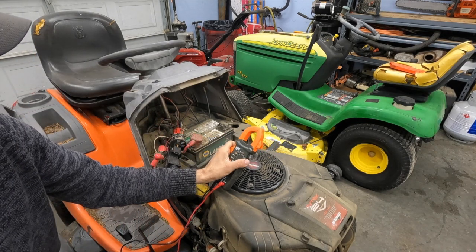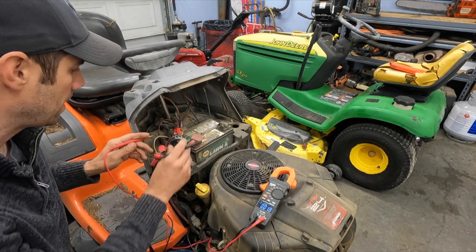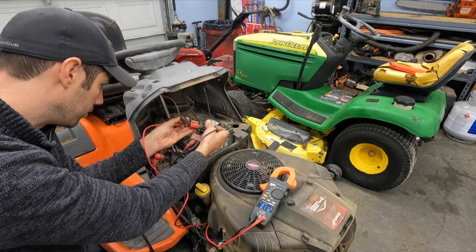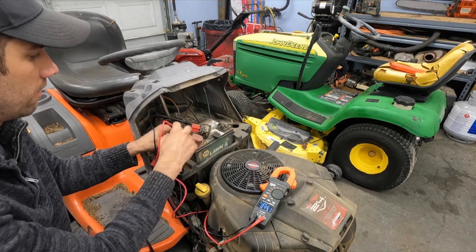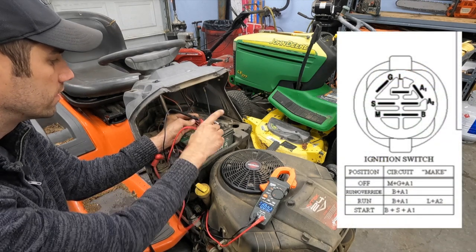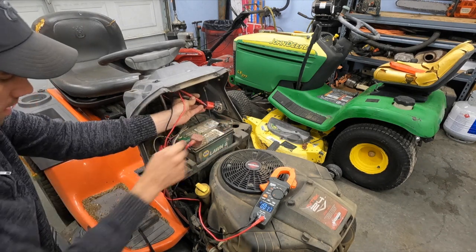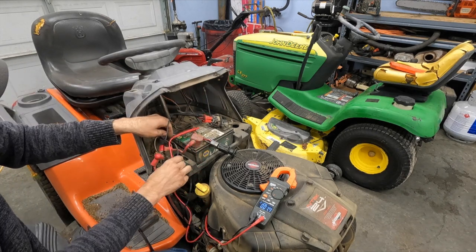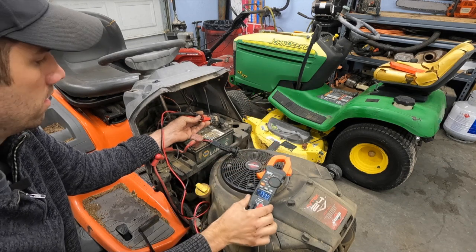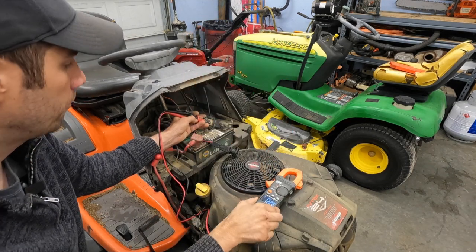For the sake of it, let's just test it and confirm. We're going to go DC volts, negative of the battery. There is a ground circuit on the back of the switch — it's going to be the G terminal. You can test with that G terminal as your ground. So we can back probe the G, which goes back to the negative of the battery, then go to B. On the back of the switches they've got labels: B, A2, A1, accessory one, accessory two, L for lights, S for solenoid, M for magneto. We're going to go to the B terminal — that's where it comes in from the battery via the solenoid on this little red wire that goes up to the key switch and feeds the mower with 12 volts. We're getting 12.27 volts. We're a little bit low, but we have 12.27 volts.